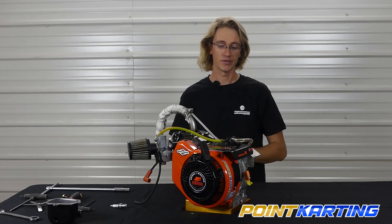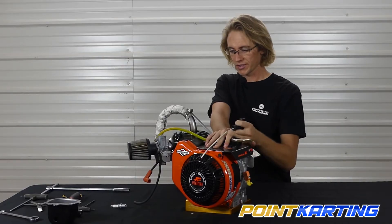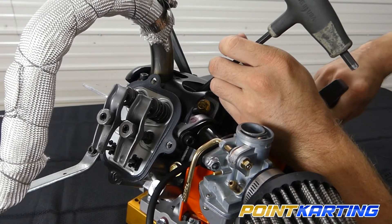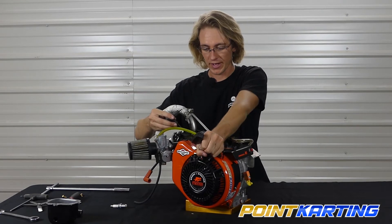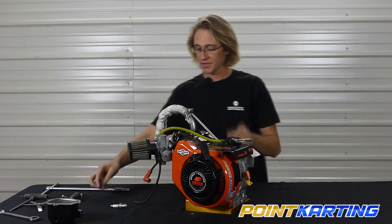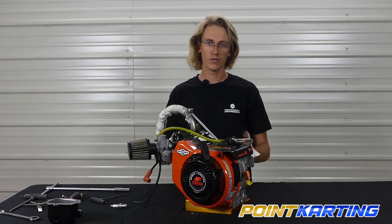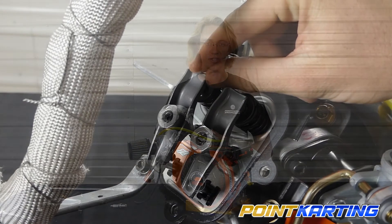On the Briggs 206, the best way to find top dead center is to find your intake stroke by pulling the pull cord, then look for the compression release — what some people call the 'flip' — on your exhaust stem. As you see that start to release, take an Allen wrench, stick it through the threaded hole for the spark plug, and feel for the top of the piston. As you continue to pull on the compression stroke, feel that piston rise up in the combustion chamber to the very top of that stroke. At this point feel your rocker arms — you will feel a slight bit of play, indicating the valves are back-seated all the way up in the cylinder head and pressure is relieved off the rocker arms, allowing us to adjust our valve lash.